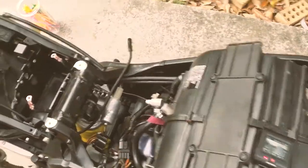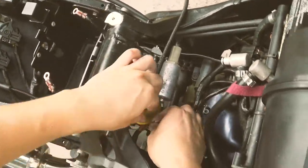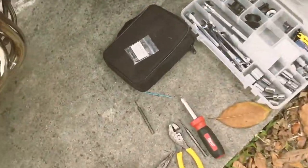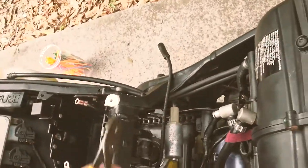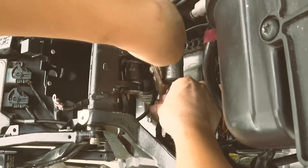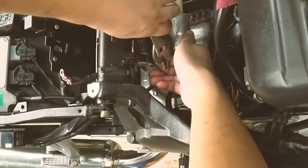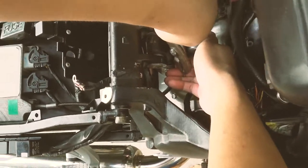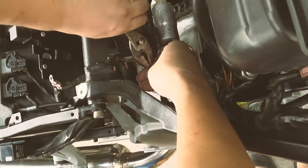All right, so I just switched to my helmet camera, the action camera. So I'm going to go ahead and replace this one just to show you guys how to replace the terminals. First, we have to get all the nasty pieces out, which you do by using a regular plier and applying some pressure on it, and it will fall apart by itself because it's really heavily corroded. And we might have to resplice the wires depending on the condition of this terminal.